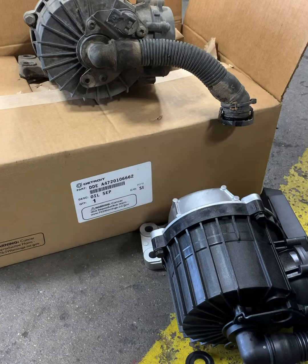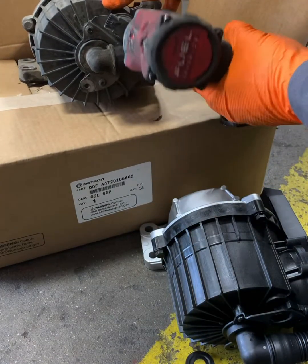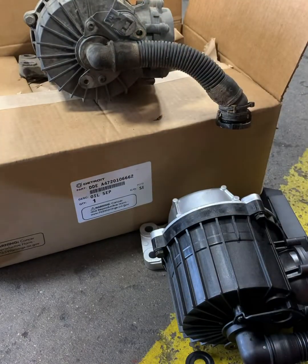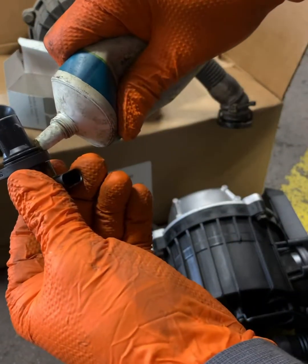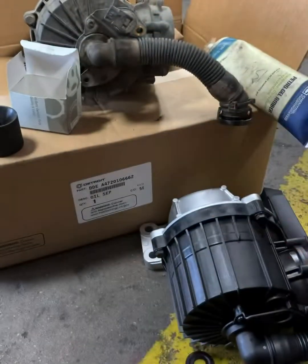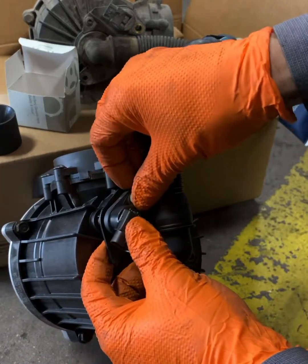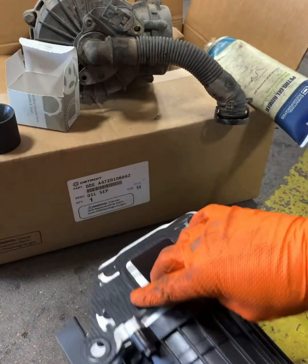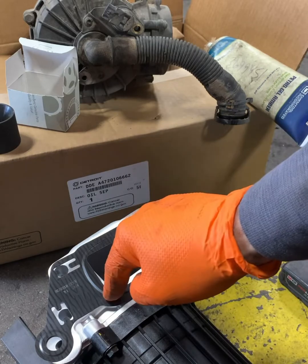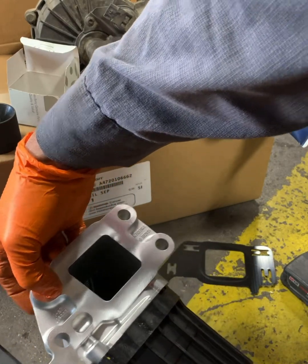Of course I grabbed the 30 and this is a 25. Just a little bit of lube on the o-ring so it goes in without a problem. The gasket is not going to stay on there, so what we're going to do is put the unit into place, then put the gasket on, and then bolt it up. The reason we're doing that is the bolts stick out too far and we won't be able to get past the wiring — they'll just fall out. Not a big deal.